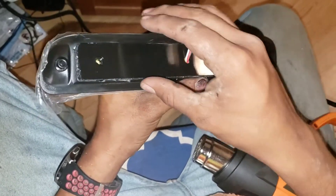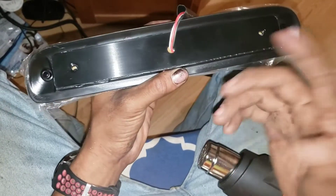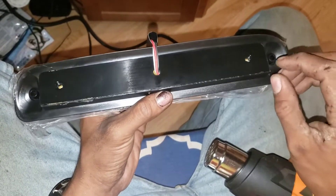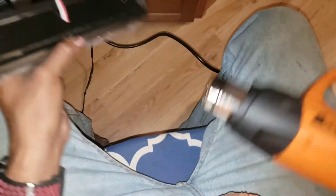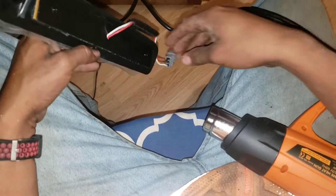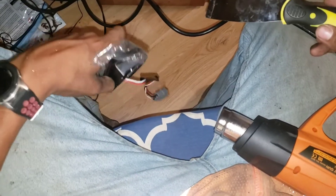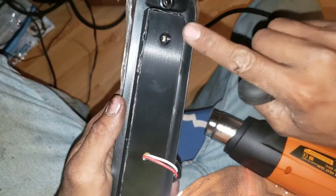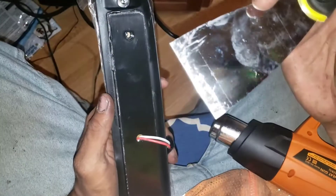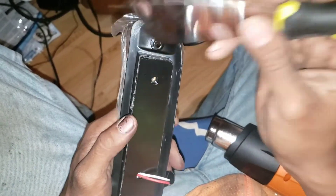You start off by removing these two first screws. This is held in by a sealant — kind of like all headlights and taillights — some type of sealant to keep out water and moisture. What I did was grab my heat gun, set it on a slow mode, and heated up one side just to get it started. I focused it on this edge, moved it back and forth so it doesn't start melting any plastic. Then I have a little spatula — pretty flat and pointy — and I just wiggled in one end.